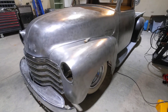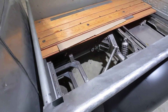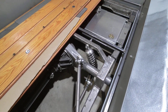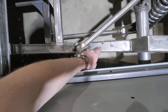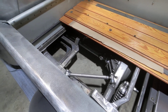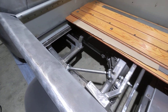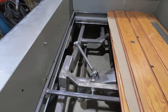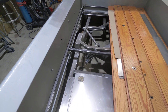The frame is mostly complete. What I have left to do is complete the boxing plates on the back half, starting right about here — you can see how it's just tacked. I also have to finish the welds on the gussets on that interior structure, and finish welding the triangulated four-link in. A couple of little things left to do in here.